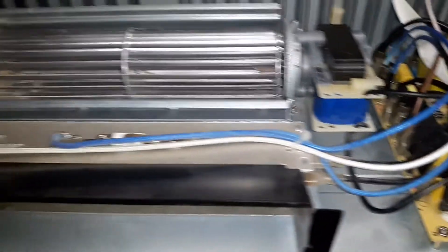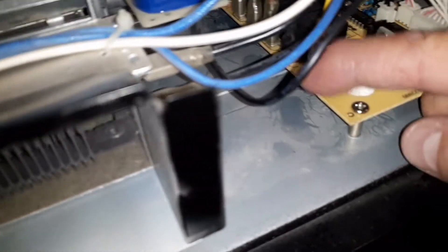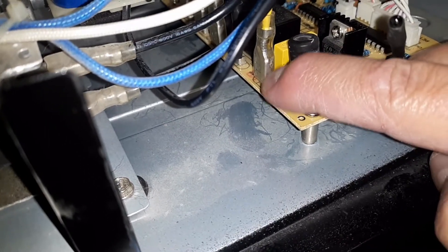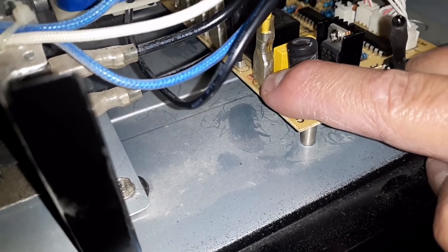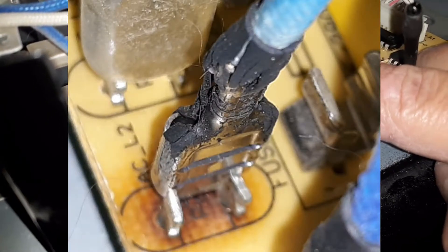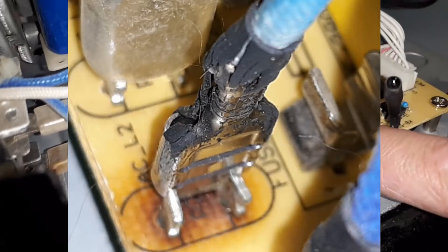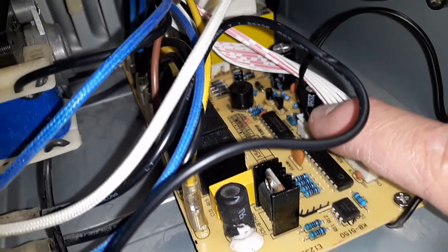There was a large amount of dust inside, so I blew all that out. All of the board connections are stake-ons or blade connectors, and they were all loose — some were even a little burnt. I cleaned those up and tightened them with a pair of needle-nose pliers before putting them back on, and inspected the board — nothing burnt.